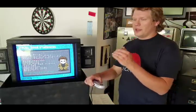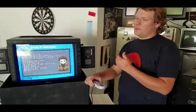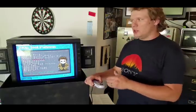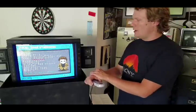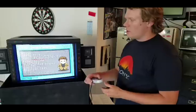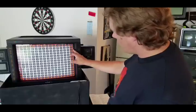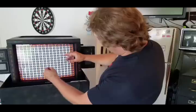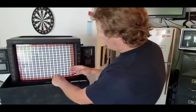With the 240p test suite pulled up, you can see right away there's a large blank area, some screen curling, and adjustments needed to the yoke. A lot of changes need to be made to the screen geometry. Many monitors let you change geometry settings without getting inside, but this one requires getting inside and turning potentiometers. I'll show you how to do that, and you can apply this information to other monitors with potentiometers — translating it since no two monitor models are identical.